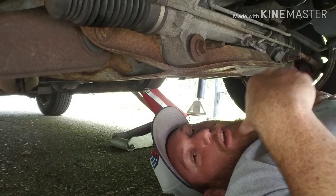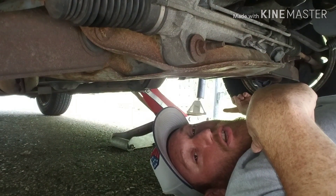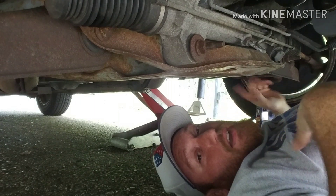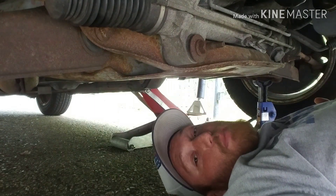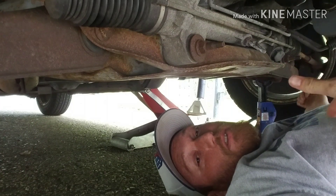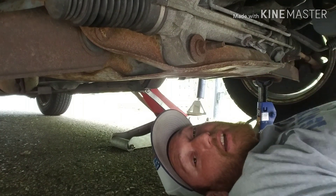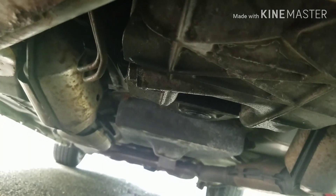The first thing you want to do is have your car on level ground, that way it's not rolling side to side or up and down, and you won't mess up your jack. Second thing is you want to get a jack stand. All this stuff's made in China so you can trust it if you want, but I'm not going to, so I'm going to put my jack stand underneath here in case this car wants to fall on me.